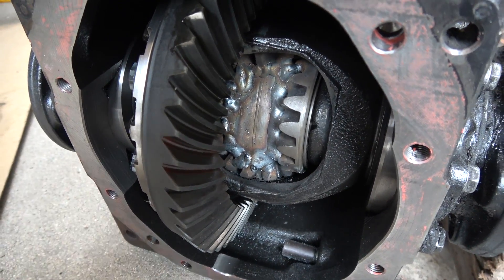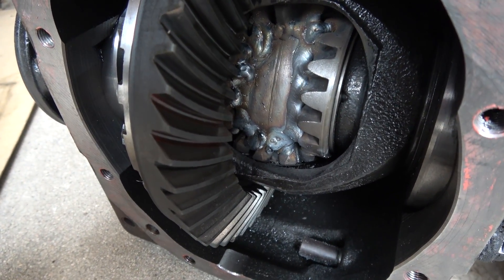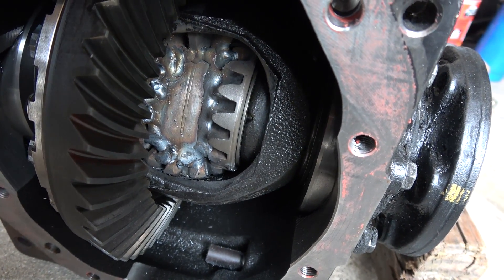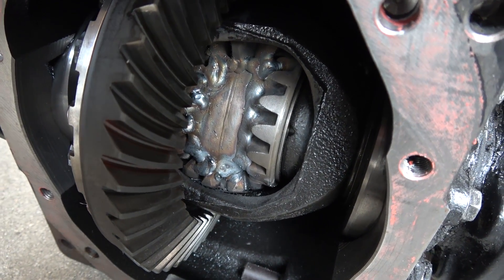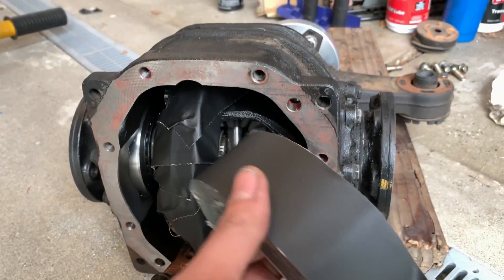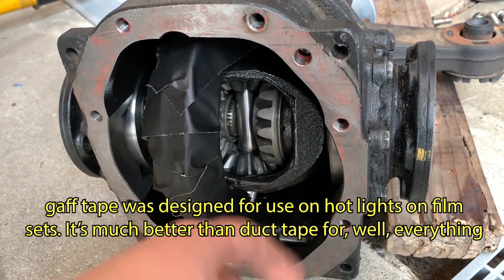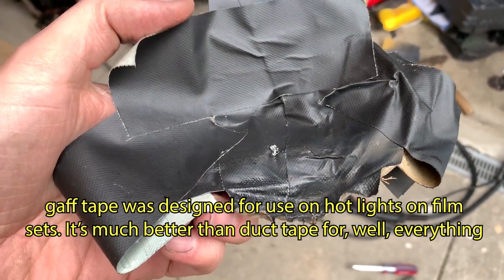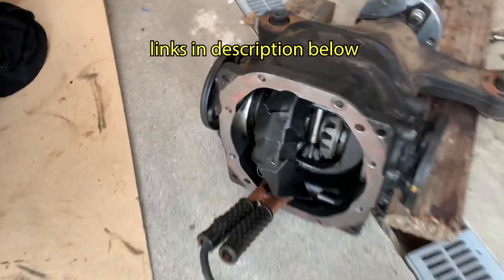And there we have it. I had to go through and clean up all the little bits of slag, but that is a welded differential. Not too bad for my first time ever doing this and being a very amateur welder — but I have seen worse welding jobs for sure, so I think this will hold together just fine. I used some gaff tape to cover up the ring gear so I don't get any extra metal balls stuck to the actual gear itself. It holds up pretty well and stopped anything from sticking to the ring gear — I highly recommend doing that.